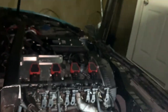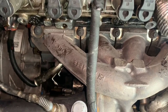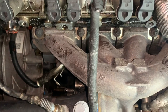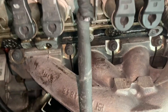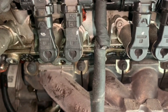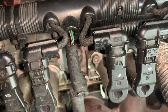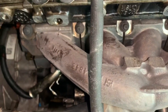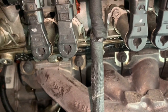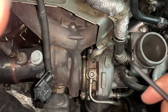Now that the heat shield is out, I can let you guys know it's time for me to do a valve cover replacement. I'm boosting really heavily, and it's been a while since I've done one. You can start to see in the crevice and corners that it's starting to try to leak through the valve cover. This is known in these vehicles when you're pushing heavy boost — eventually it'll start seeping down. I can already see a little residue, so inspecting your car like this can reveal other issues. That can be another video.